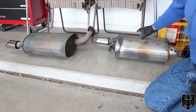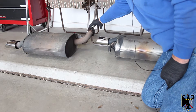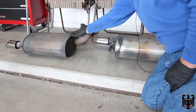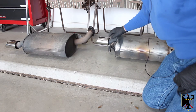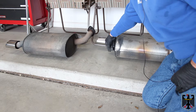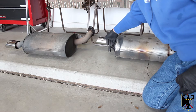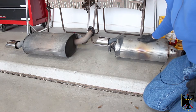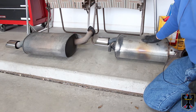At this point we've removed the right and left rear mufflers. To do that we took the bolts out, but before we took them completely out we put a floor jack underneath the muffler to give it some support. We took the bolts out and then we were able to manipulate the muffler left and right to get the little rubber rings that hold these onto the car, get them over and off, and pull them out without really any problem at all. Pretty easy if you just use good logic.